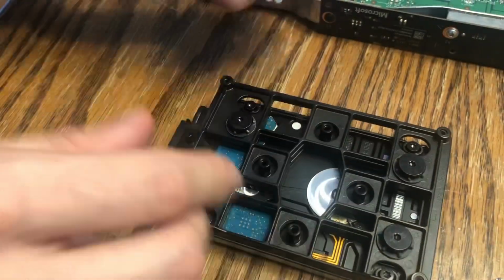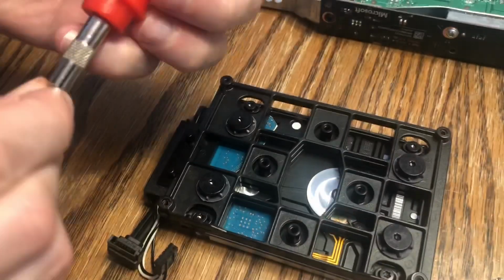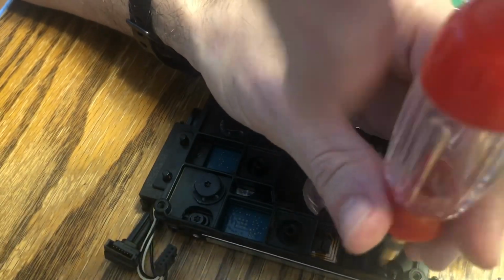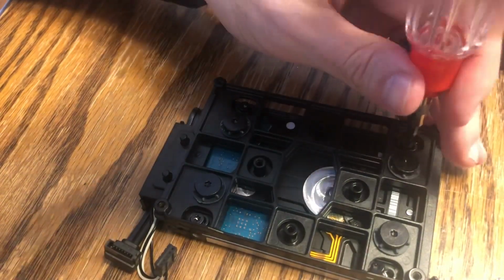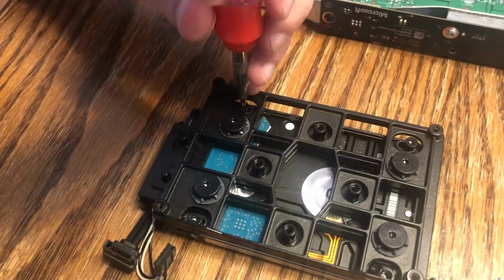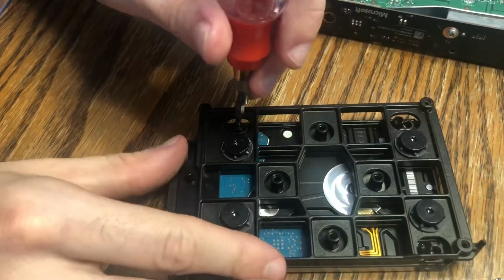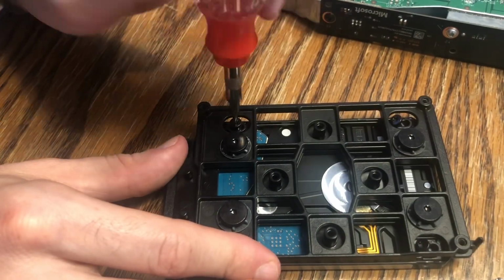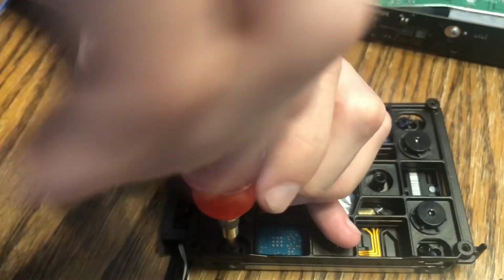Alright, so that thermal paste was bone dry. I'm glad to have been able to replace that, and now the last step here is swapping out the hard drive for the solid state drive, but you can't just put in any hard drive and expect it to work. There's partitions that you have to have added, and XFIX outlines all of this on his channel and provides scripts and steps for you to be able to do this yourself.